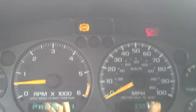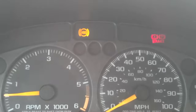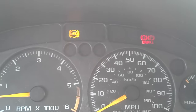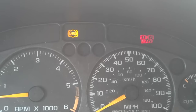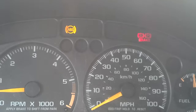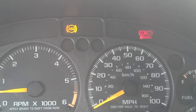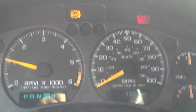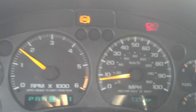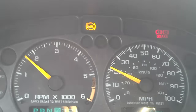Okay, now it's on, as you can see — miles later, but it's on. I'll go ahead, probably at lunch or after work today, and pull the grounding wire off behind the radiator grill and clean that up and see how corroded that is and try that. If that doesn't work, we'll have to take the ECM off and rebuild it, but since I'm driving now, let me get back to driving.